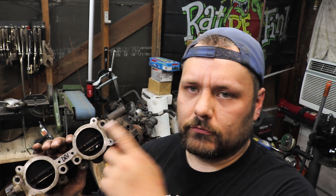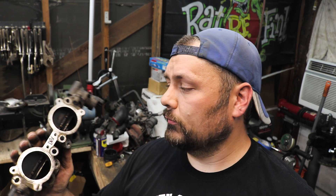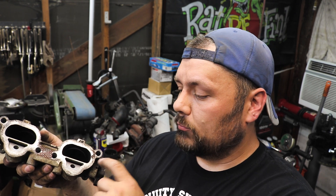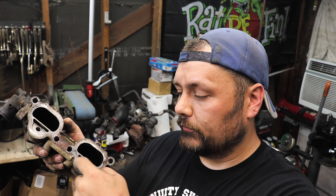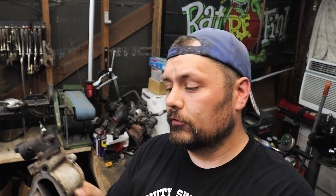To delete these, there are three ways I've done it. One: you just take the flapper valve out — it's quick and easy. You just grind these screws out, pop the valves out, and you're good to go. You leave everything else alone so you're not plugging up any holes. The second way — and what we're doing today — is to take the valve out, the rod, the motor, and the sensor, and then cut, blend, and polish the whole housing itself so it flows as well as it can. The third way is to just buy a deleted housing from someone like IAG — a CNC billet piece. It probably flows better than the DIY version, but since we pride ourselves in our DIY ethos here at Engine Newity, let's do it ourselves.